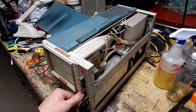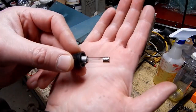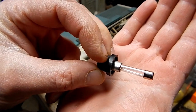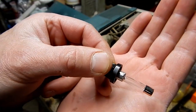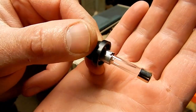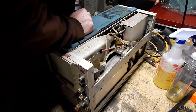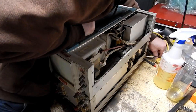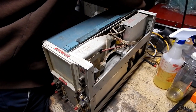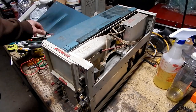Pretty much nothing — and check that fuse. Do you see what I see? Does it look like there's nothing in there? That's because the entire guts of the fuse vaporized — it's actually a fine spray of vaporized metal on the glass now. This is what we call a hard short or a dead short, which I like. Dead short is far more easy to diagnose than an intermittent or a high resistance short.